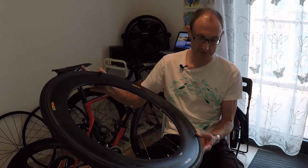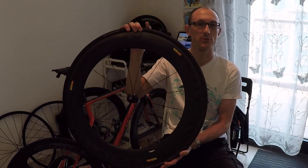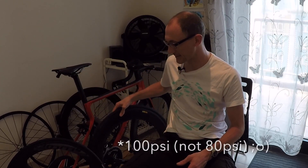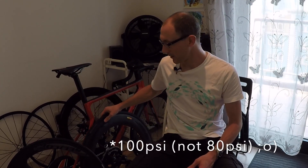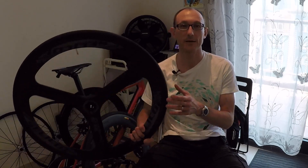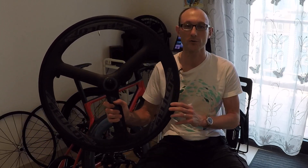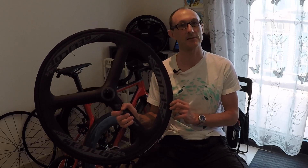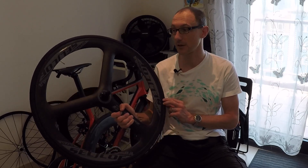On the Mavic we've got the Continental Competition tubular tires. All wheels were pumped up to 80 psi for this test. The interesting thing is that both wheels performed almost the same. The CDA when using the tri-spoke was 0.24 and the CDA for the Mavic was 0.242. That means the tri-spoke is about 2.1 watts faster at 40 kilometers an hour, or about 10 seconds faster over a 40 kilometer time trial.